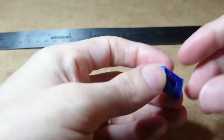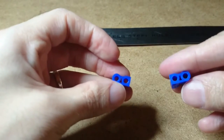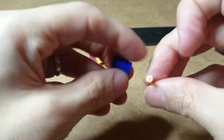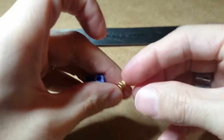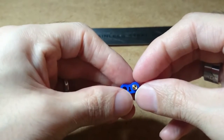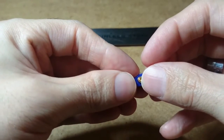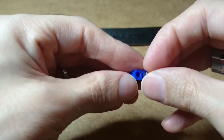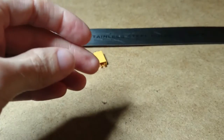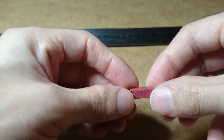The problem with the stock battery is they only came with EC2 plugs, and the problem with EC2 plugs is they are a nightmare to try and solder onto an aftermarket battery. Your gold-plated bullets when you're soldering them — when you're putting the solder and then putting the wire in — the bullets need to be quite warm for you to punch them into the plug. If you don't time it right or you get too much solder, you can't get them in right and you're sitting there battering away at it and it takes ages. I just didn't like it at all. It was really difficult. So I changed my mind — I didn't want to go for these EC2 plugs because they were too difficult, and I can solder just about any plug, but they were just a nightmare.